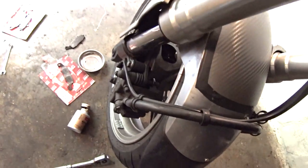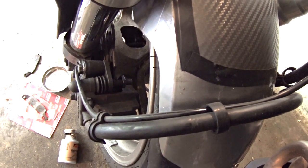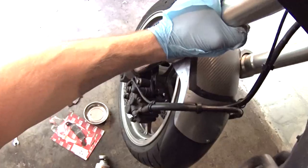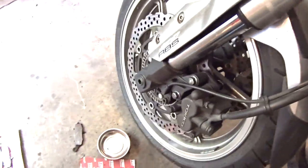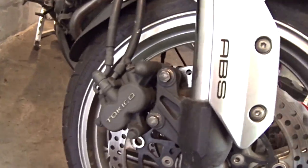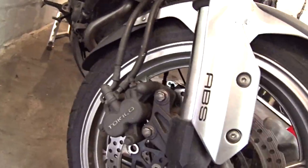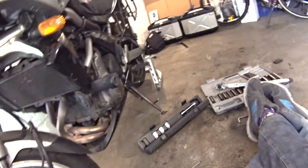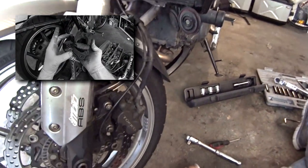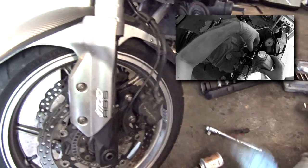So now we just need to give a couple of little squeezes on the brake lever - the pads tighten up and hopefully that works lovely. So there we go, that's the brake pads changed. In the interest of keeping this video short and exciting, I'm just going to tell you that the other side is exactly the same, just the other way around - so do the same as that but apply it to this one. Thanks very much for watching, that's your front brake pads changed. If your brake servicing itch is not yet scratched, check out the video on changing the rear brake pads, or if you're feeling really saucy, check out the one where I changed the brake fluid. But till next time, thanks for watching - see you later.